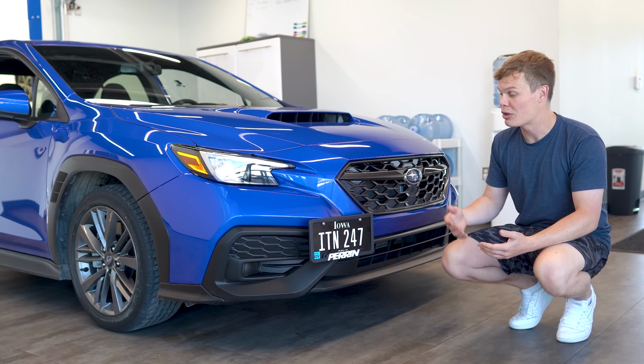Now, both of these coilovers have different spring rates, different valving, and different damping, all to improve their performance. The FR-Spec over here is going to be their top of the line performance coilover, and again, it's got all these redesigned features. It's got 30-way adjustable damping, and they've also made the camber plates a little bit more offset to give you more negative camber. Now, Kevin runs the FR-Spec in his FRS, and I have to say, these coilovers actually ride really well. They do awesome on track, but if you want to drive around town and take your car out on the street, they work fine for that too. So if you guys are looking at new suspension, you might want to check these out.